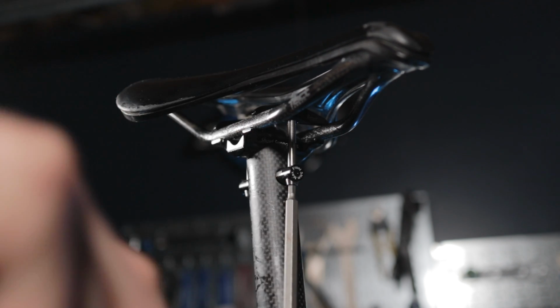And then the second little gripe I have, which again, I'm not sure if this is something that could be avoided, but the front bolt on the seat post, when you go to torque it down, there isn't enough space between the actual seat post and where the bolt is, right? And so as you're trying to get a torque wrench in there, if you look at a torque wrench, the head on the torque wrench is somewhat bulky, right? It's like a regular ratchet. Even this Park Tool, which is meant for bikes, even though this is a rather small head, it still kind of bangs up against there.